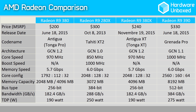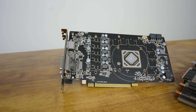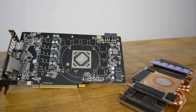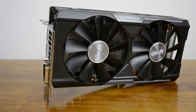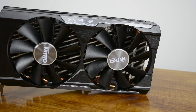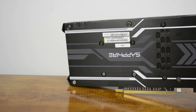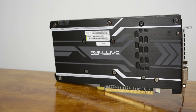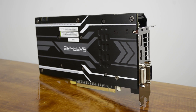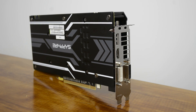The 256-bit memory bus is also used by the standard 380 and Radeon R9 285 before it. Unlike the 380, the 380X comes with a 4GB GDDR5 configuration, as AMD isn't just targeting 1080p gaming but also 1440p. AMD has rated the 380X at 190 watts TDP — the same as the 380 — though we expect the beefier 380X to use quite a bit more power. The default clock speed is 970MHz core and 1425MHz memory, providing a data rate of 5.7Gbps and a memory bandwidth of 182GB/s — far less than the 384GB/s of the R9 390.